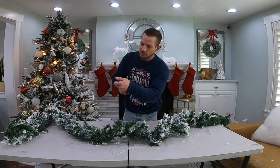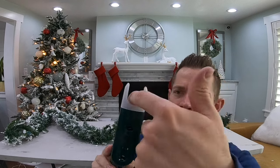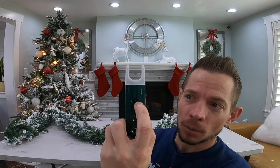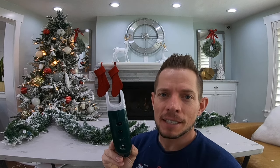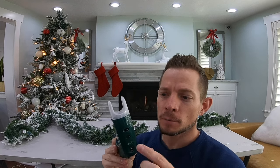In order to use this tool, it has a few different settings. A quick rundown: it comes with a sensor gauge that you run over the wire and the lights. It has two settings — one for LED and one for incandescent bulbs. You need to know the difference; it will say on the package. A good way to tell is if you can see a bright yellow light inside the bulb, it's incandescent. If you see a little diode with a more white light, it's most likely LED. If you're not getting the effect you want, switch it back and forth and see.